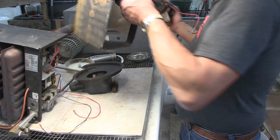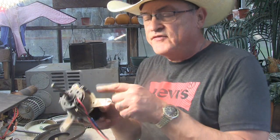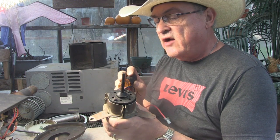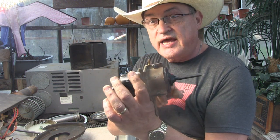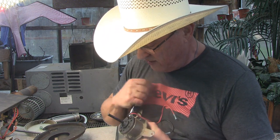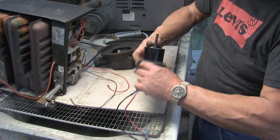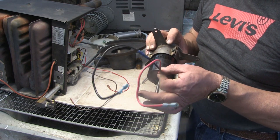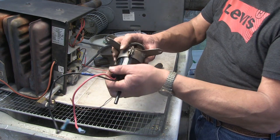The motor's free — it's free, but not quite. We've got to remove this rack here. We just have to loosen — not completely remove — just loosen these three Phillips screws to get that out. Pay attention: you have a long shaft here on the motor and a short shaft here on the motor. Pay attention to how you're taking it out, because that's the same way you're going to put the new motor in — it's got to go back into the same place, the same method. Make note of where the wire positions are to this thing. You want to make sure your wires go exactly the same way with your other motor. So let's pull that out of there.